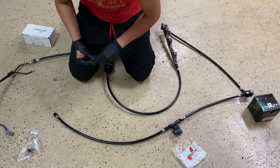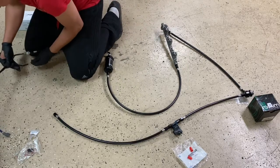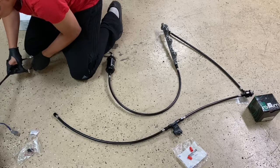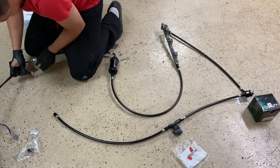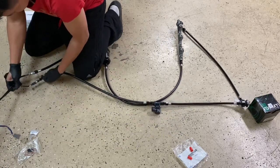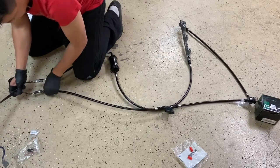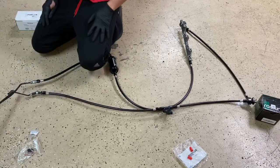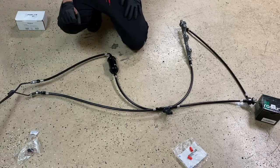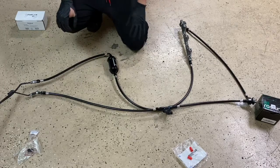Get one of the hose clamps and push in as much as possible. It's a little trickier if it's on the car, but easier if you're outside. The line goes in here. That's how I have the setup on my track car — the whole line is PTFE rated and E85 compatible.